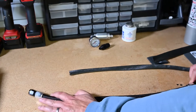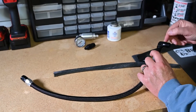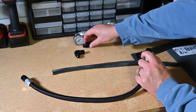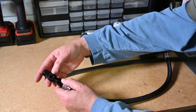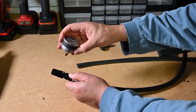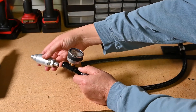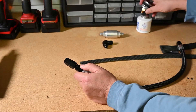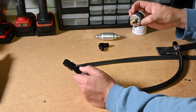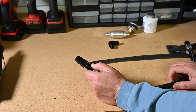One last thing: I'm going to use thread sealant on the 3/8 fitting that goes into the pump. That's the only place I'll use thread sealant — on the AN fittings it's not recommended. You just tighten them up and they seal. Don't use any Teflon or thread sealer on those. The hose itself is 22 and a half inches with the fitting that goes into the fuel pump. On the other end going into the filter, we've got an AN fitting where the gauge will connect, then through the filter, into the carburetor.